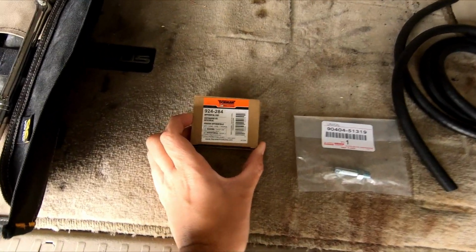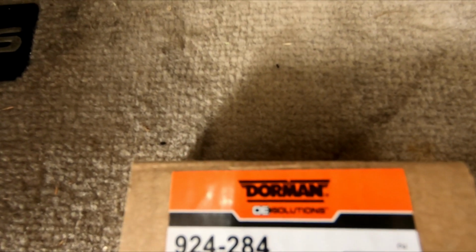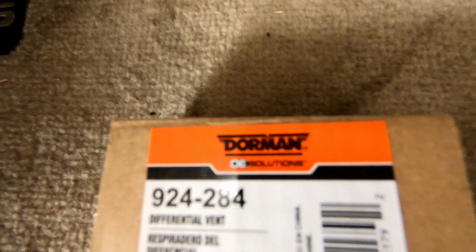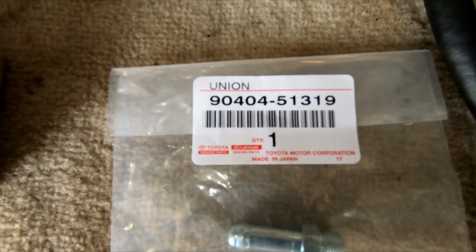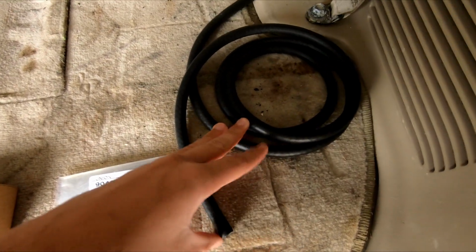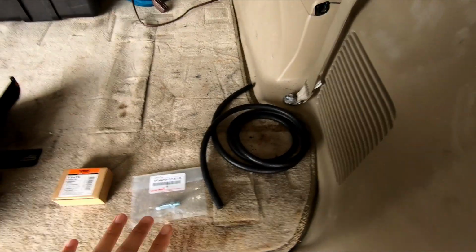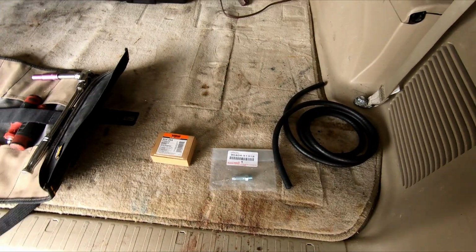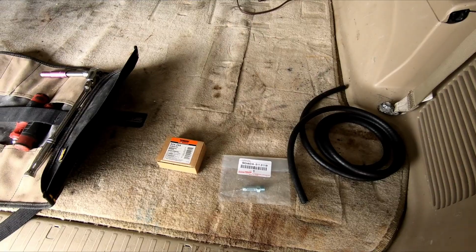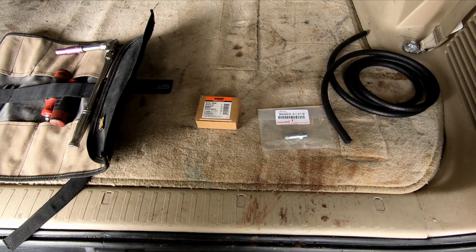This is a differential vent from Dorman. It's just a generic thing I got from Advance, but I found it on Amazon as well, and that's the part number. This is an OEM union, and there's the part number on that. This part will thread into the axle housing. You'll take your tube, 1/4 inch inner diameter, and run it to the vent. I will link all of these products in the description so you can go grab them if you want to do this job yourself. They are all available on Amazon, and if I remember correctly, they're all on Prime, and this stuff is like 14 bucks for everything. So let's get into it.